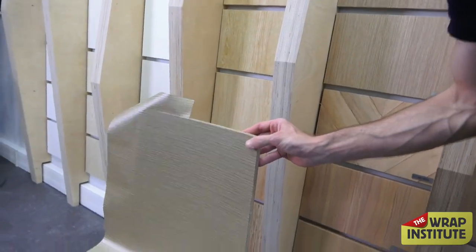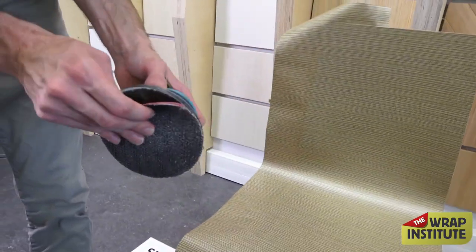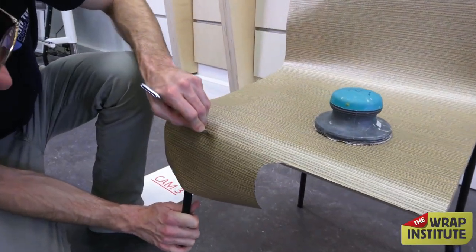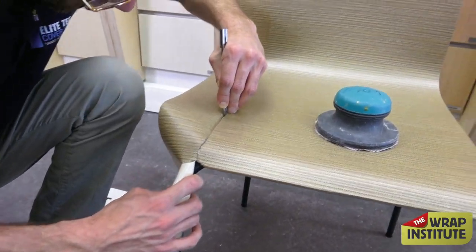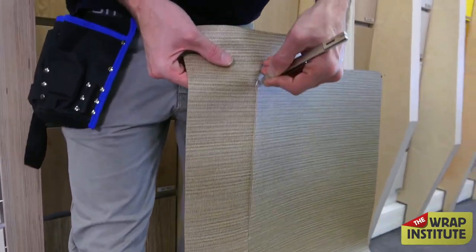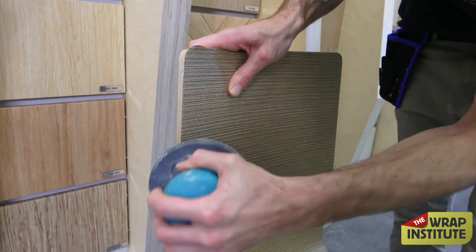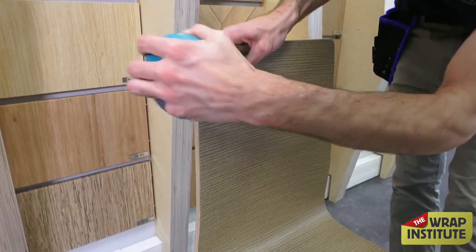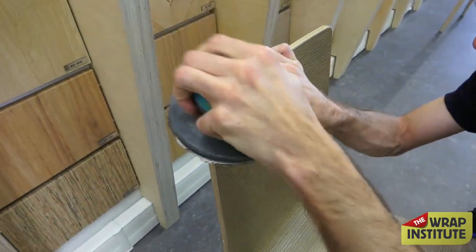Interior film is super thick, very similar to PPF. With PPF you're either cutting the material short from an edge or wrapping all the way under. Here you don't want to wrap all the way behind the chair, so you cut it flush to the top but not too far back. He's now using 120-grit sandpaper in a modified knife-sand technique — cutting the excess material with his blade at 90 degrees, creating a little excess right on the edge, then coming back in at a 45-degree angle with the sanding paper.